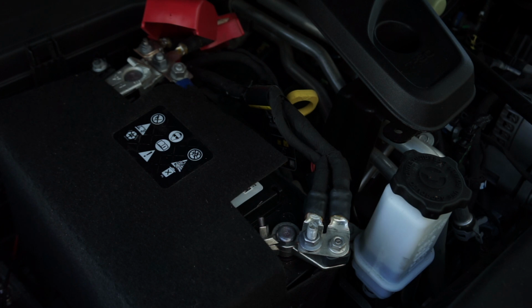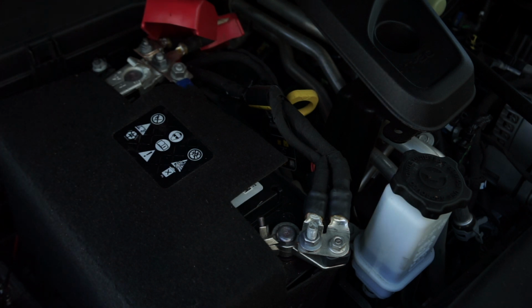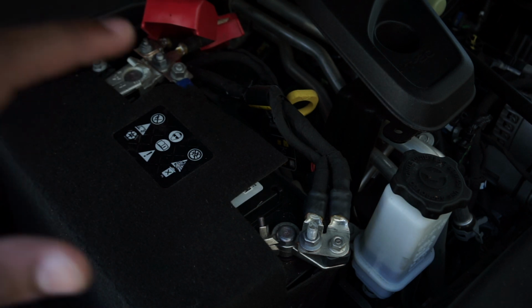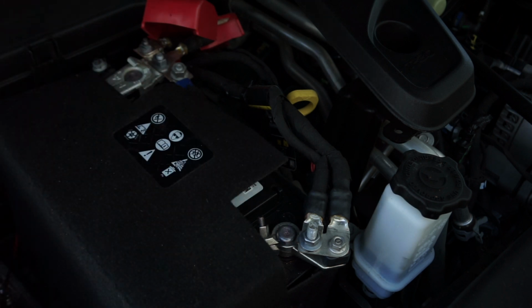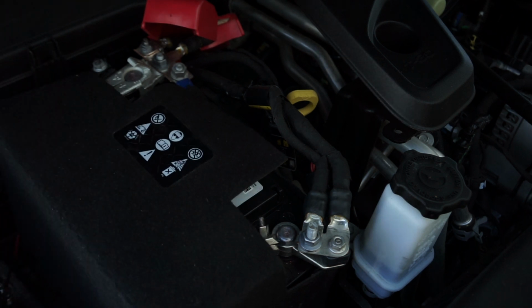Again, because I was doing it in my garage. And so I let it sit for another day, and came back the next day, and the auxiliary battery was completely dead because everything was drawn off of that all night long. Because the main battery charges the smaller battery as well as the alternator, and they all work together. So if you have the main one gone, everything is going to come from the auxiliary battery, which is again a motorcycle battery. But yeah, so go ahead and remove your terminals.